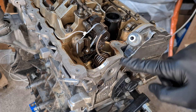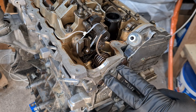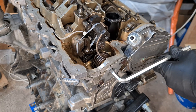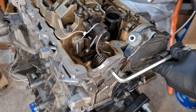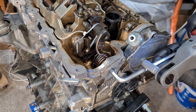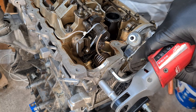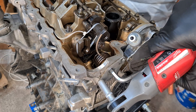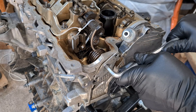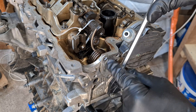I'm going to show you how to do that. I've put a mark here because I want to know how much the carrier rotates when we remove the bolts. I'm going to put the allen key here and keep it under tension. Now I'm going to remove one of the bolts. I really have to hold this under tension — if I don't, when I unscrew the bolt far enough it will damage the cylinder head because it will be under tension. Make sure you put some tension on it. Now we can release the tension slowly and observe what happens to the spring when we remove the carrier.